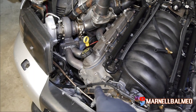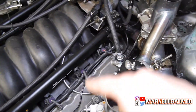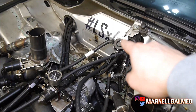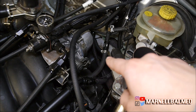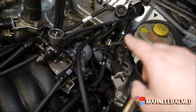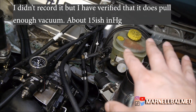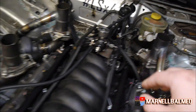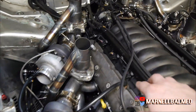Here it is fully hooked up. From the valve cover there's a PCV valve going into a catch can with a bypass just in case, and then that goes into the intake manifold. I do have a one-way flow valve there so boost doesn't go into the crankcase. The one thing I'm concerned about is whether this side will pull enough vacuum to make the brake booster work.